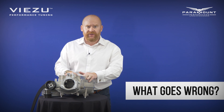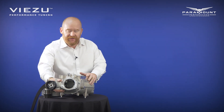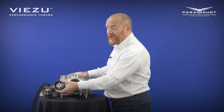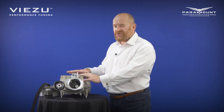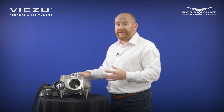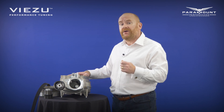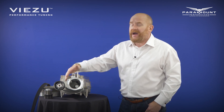Whilst they're incredibly reliable, there are two things that tend to go wrong. First, there's a set of bearings in what's called the snout. These snout bearings can develop too much free play, and what you'll notice is when you turn the pulley by hand you get a clonk-clonk-clonk noise that shouldn't be there. When it's fitted to a car, the most obvious sign is when you turn the engine off — you'll get a series of knocks as the engine is stopping. That indicates free play here, and eventually if untreated it will break up and become a problem. So if you start to get a knocking from the front of your supercharger — most obviously when you turn the engine off — it's time to get the snout bearing changed.